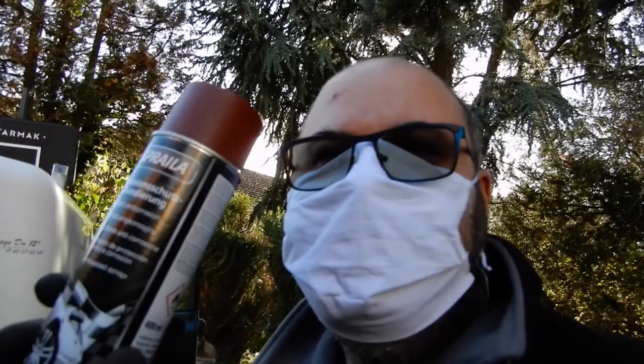primer coat. I've suddenly realised that I've treated one side of the van, and I've treated the back. Then realised I had to treat some of the back again, because there were some bits I'd missed with the rust treatment, and I hadn't done the offside. So that means that I can do one side of the van with this stuff, but I can't do the rest because I've got to wait for it all to dry. So that's a bit silly, because it means that I'm going to have to do that tomorrow.